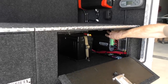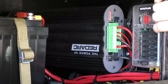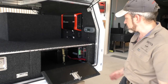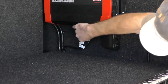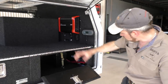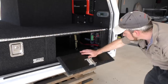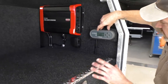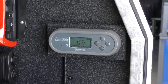This unit here is the DC-DC charger — the REDARC 1230S2. This is a big unit, state-of-the-art electronic technology. This DC-DC charger allows DC input from the engine, it also allows solar input, and it also allows 240 volt input. If you're on a powered site, you can just plug that in and it'll keep your battery charged. You can also plug in a solar panel to the rear — it all runs through here, boosts the charge, and keeps your battery going. The display for the 1230S2 controls the system and gives you all the information you need about how it's operating.